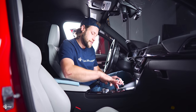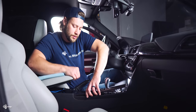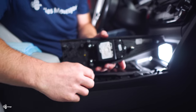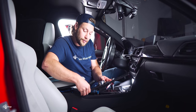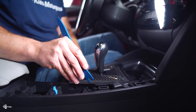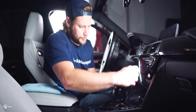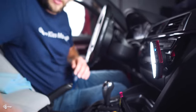The first part of the process is getting this piece of trim off. I just take my hands — I don't really use any tools — and I pop it up over there, pop it up over there. There's a connection that plugs right in there, so once you unplug that, you can set it out of the way. I always recommend taking the front off first and then lifting up. You're going to have to open this, but it's super easy. Take a very thin trim tool and carefully go in here to pry it up, then pull it off by hand. This does have one connection for your drive logic, so you can disconnect that and set it to the side.